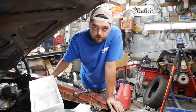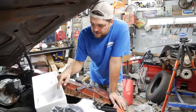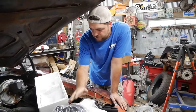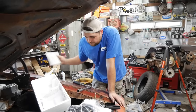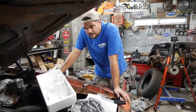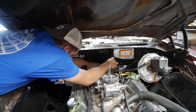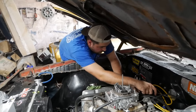I've always wanted to play with one. However, the balancer on this engine is slipped, and you have to install this at 10 degrees before top dead center. I bought a piston stop just to make sure, and some timing tape too. First thing I'm going to do is pop the distributor cap off and see if the balancer is really that far off. Number one points right here — here are the timing marks on your Pontiac.